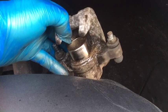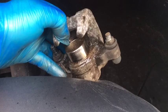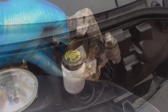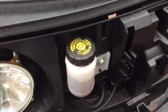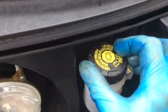If I don't take the cap off the reservoir, I'll burst the reservoir. If the piston goes in easy, it means all is well, but if it's quite stiff I'll need to pop the piston right out and give it a thorough clean inside the caliper. The brake fluid reservoir is located under the front, so I'll just remove that.